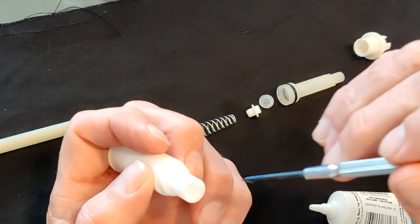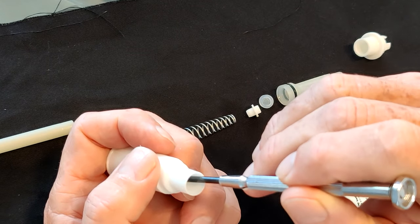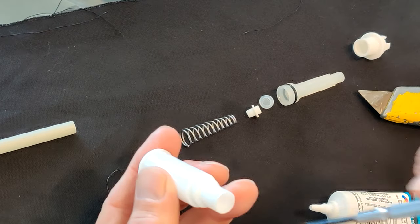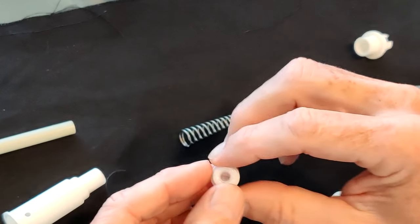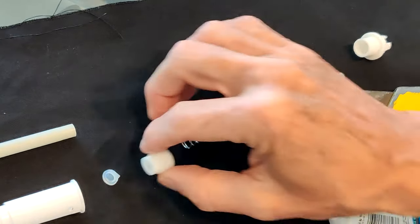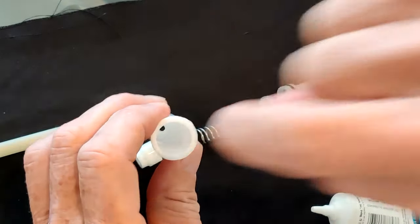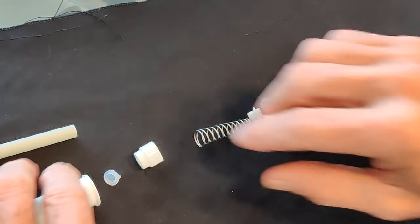There's another little valve and plastic piece in here. If you take it out, be careful — that little valve is not very sturdy. Use a screwdriver very gently to get it loose. Be careful: the screwdriver can scratch or nick the valve and then it won't work anymore. So there are two valves total. This is the order everything goes: spring sits here, valve sits here, this goes into that — that's the orientation.